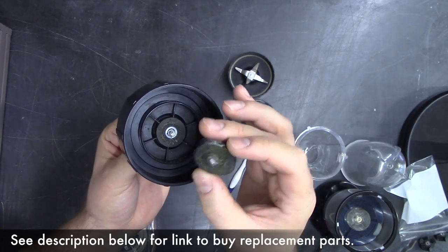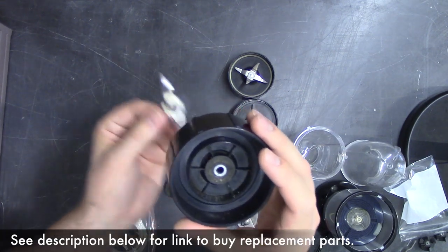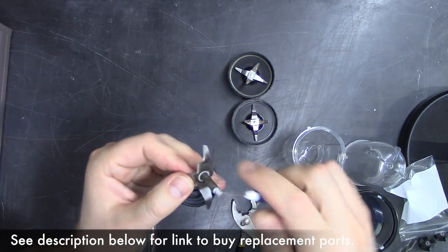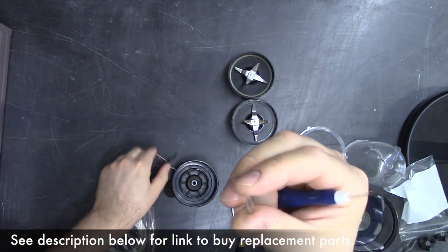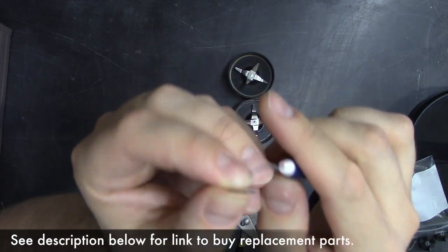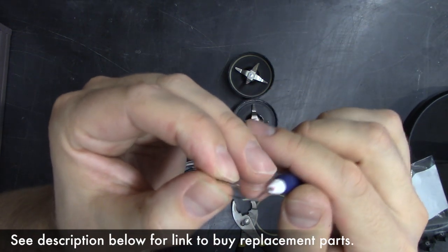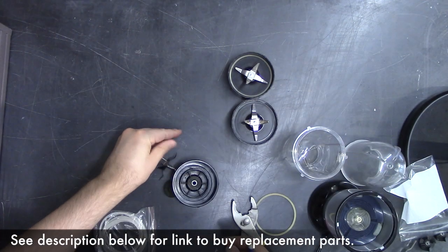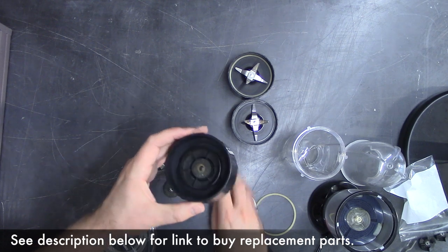As you can see, it's very gross — a lot of green smoothies made. Right here, let me get my pick tool. This gasket — sometimes you'll notice that the gasket's totally missing. Other times you'll just see that it's worn very, very thin, and that allows the liquid to pass through. So take off these two, just like that.